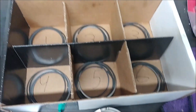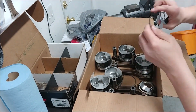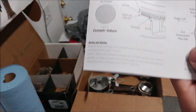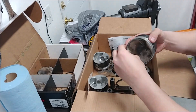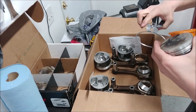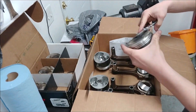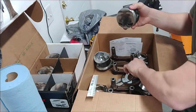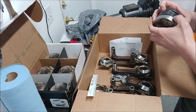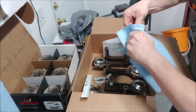All the rings are good to go — just got to throw them in each piston. You want your top and second rings to be completely apart from each other, 180 degrees. In regards to installing your piston rings on your piston, you can do it by hand but you run a risk of scratching the side of your piston or the crown, or you could just use that little circlip-style tool. They make a super fancy one but this one did just fine.